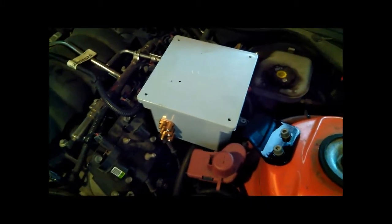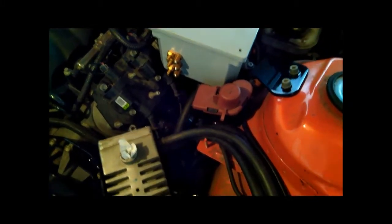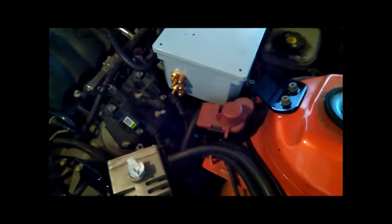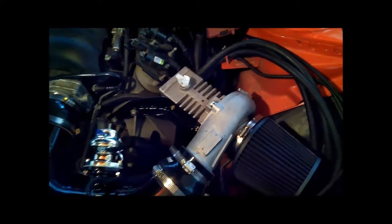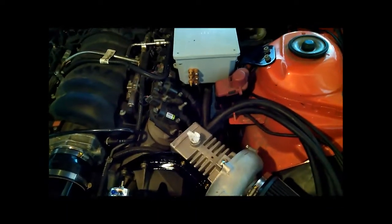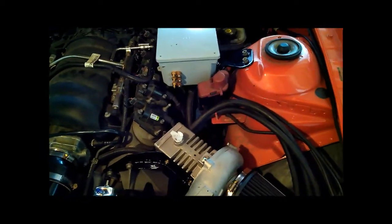I've already started to work on the wiring. I've got a ground connection here to the chassis that I just installed today, and the other line has to be connected to the batteries in the back through a large cable I've already routed — that just needs to be soldered. I have to connect the three supercharger cables to the posts, trim the wires, do proper crimping and taping, and once that's all hooked up I have to connect my actual controller box and start doing diagnostics from inside the car to make sure all the sensors are reading properly.